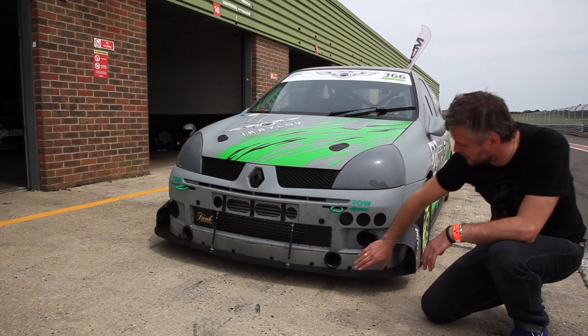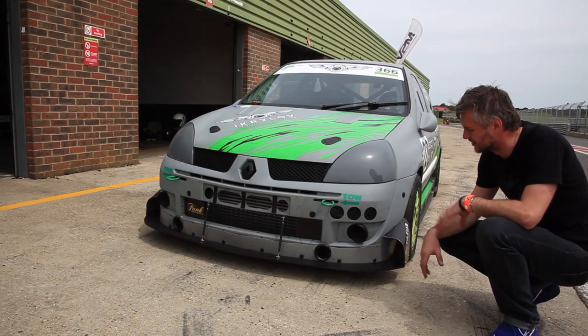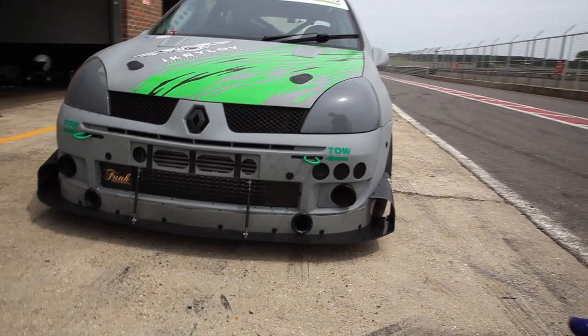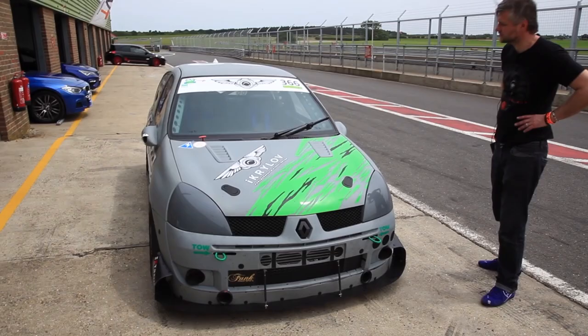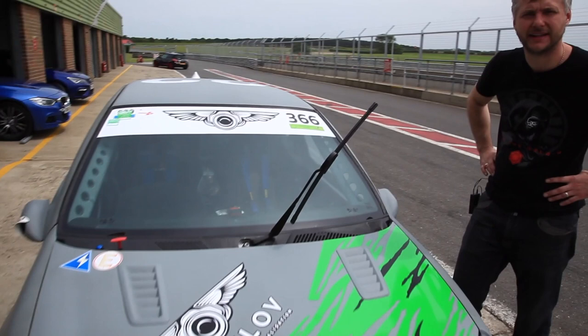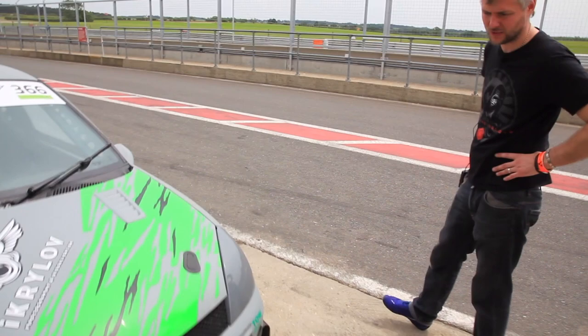Then we have livery graphics. At the front, we have quite a few air scoops — those are for brake duct cooling. Front splitter with my homemade knuckle duct things. I don't know what you call them, I think it works. Even if it doesn't, it looks cool. The original one I made was out of 12mm marine ply; this is HDPE plastic. I think it's a little bit too flexible, so I'm not too sure about that. Single wiper conversion — almost like I was born in Essex. I can actually put it right in the center for extra kudos points, but I don't really do that because we're at the racetrack and we are all serious.